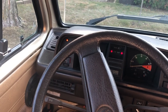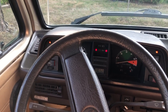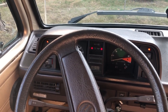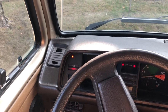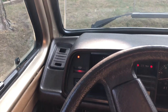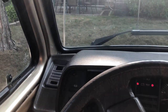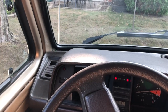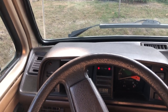If you're like me, you've probably taken off and left the emergency brake on. In this 1985 model, the steering wheel is quite big and actually hides the brake light warning light. So I added another LED just above it, up in the corner, so that I can see when the emergency brake is on and when it's off. I found that very useful — I avoided overheating my brakes and wearing them out.